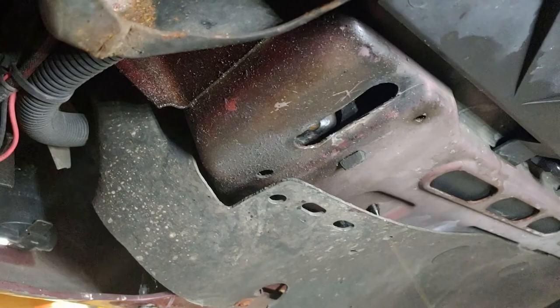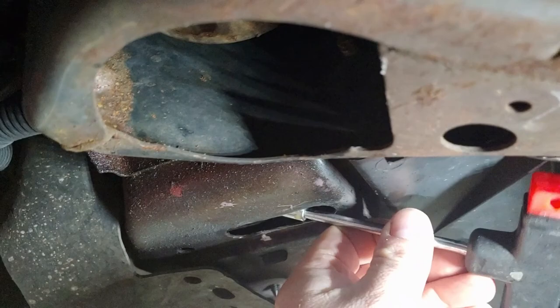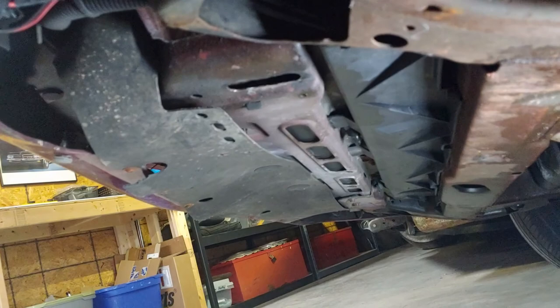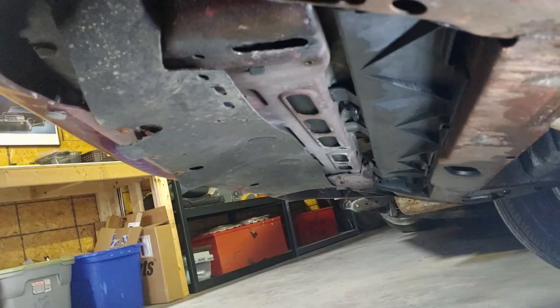You still follow the edges and you don't cut your fingers - don't reach in there. It's still pretty tight. What I did - I had this cheap T-handle, put a little cut in it, and you come right up in here. Open and close it - easy day. Price is right, basically free. Cheap tool I had laying around, deleting a little bit of metal. You can get in there. A little life hack there for dealing with these curveballs these Cadillacs keep throwing at you. All day.